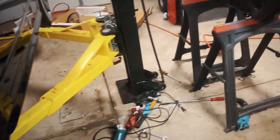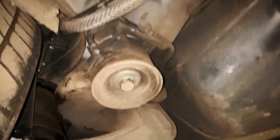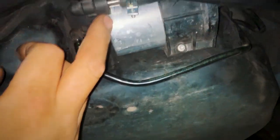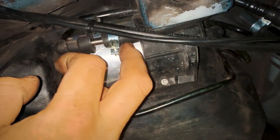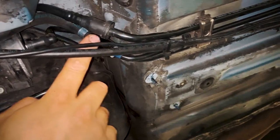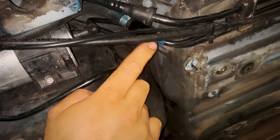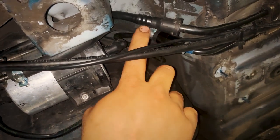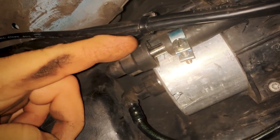We're under the B6 now. I ended up using what are called Bundy connectors — a Bundy straight to 5/16 barb on each side. This is my return line — I used the solid return line that comes out of a 3-liter. I put a 5/16 quick connect on one side and a 5/16 barb on the other side, with nice hose clamps. I'll throw a link because it's really easy to do. I ran it to the blue line.